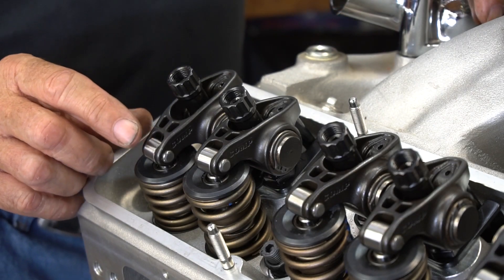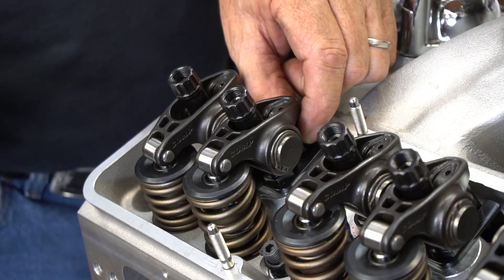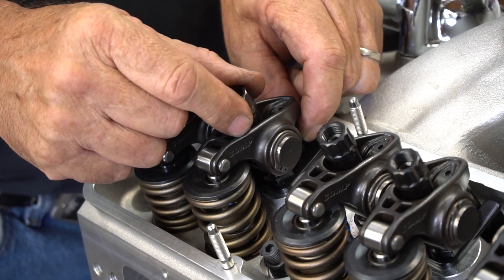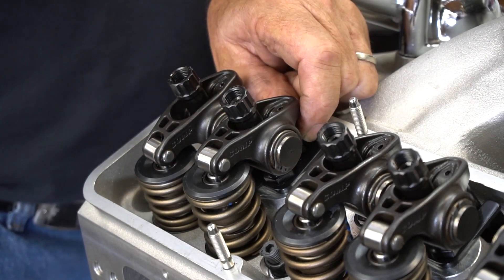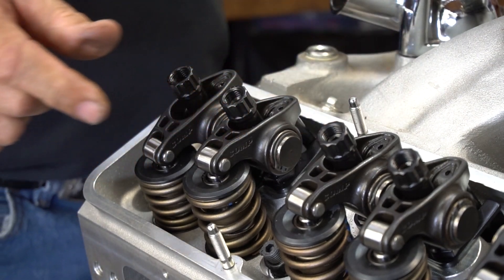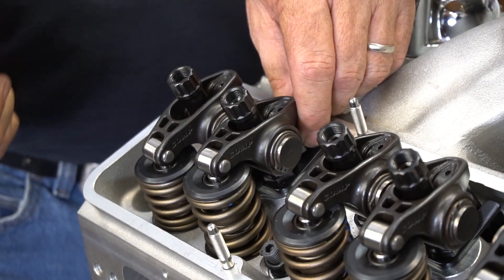Now for hydraulic preload. We've already opened the exhaust side up, so now we're going to set the intake side. Bring your fingers in here and touch the push rod — you can feel it's loose. What we're looking for is to establish zero lash. This is critical because some lifters will easily preload; that little piston will push down really easily, so you have to be very precise. At one point you'll feel it tighten up — right there is zero lash. Once we're at zero lash, take the wrench, stick it on the adjuster, and roughly an eighth to a quarter of a turn, and then you're set.